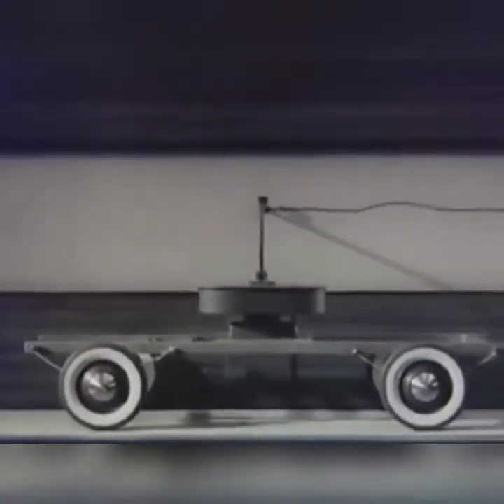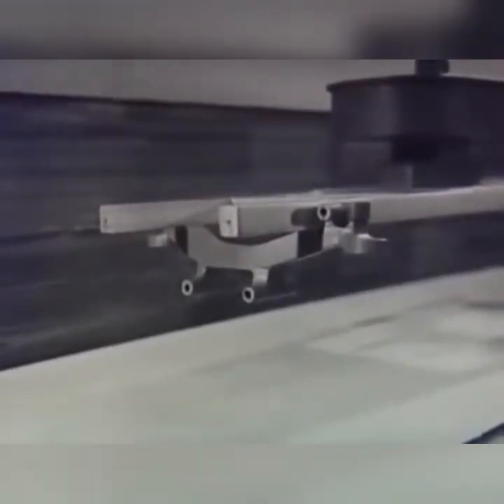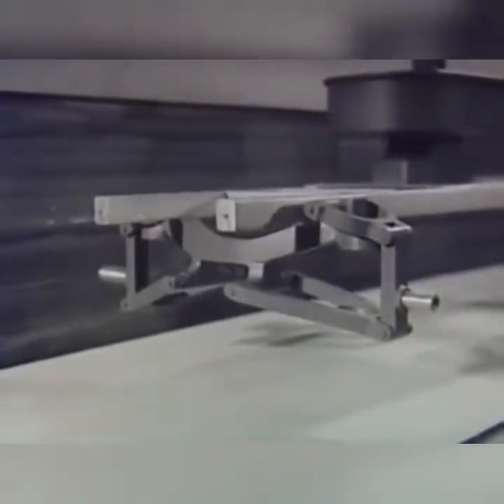The traced line shows this clearly. The only way to eliminate this unequal springing and make the front springs soft is to give them only one job to perform: the job of absorbing bumps. Suppose we replace the bouncing axle with a rigid immovable beam. Now the wheels can be fastened to the beam by two parallel swinging arms. The wheel is pivoted so that even when the arms are tilted by a jolt or bump, the wheel remains vertical and in perfect alignment.